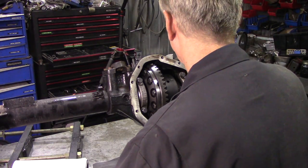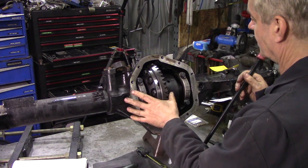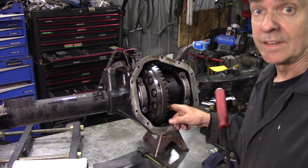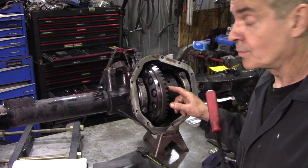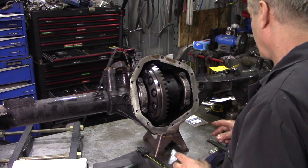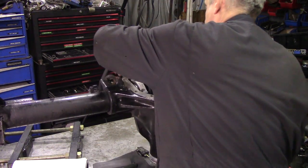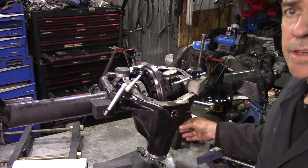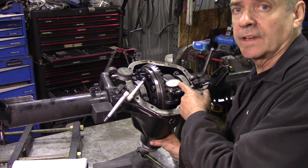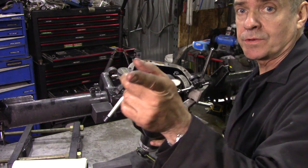Now with a bit of luck we should be able to move this crown wheel back and forwards. But this time we're hitting the pinion, which is a good thing, because once we put on here to get our backlash we can work all this lot out. I'm going to set up some gauges - this is going to be tricky to see. I've got this gauge here for the backlash going this way, and I've got this gauge here measuring the depth going the other way.